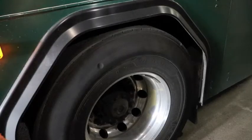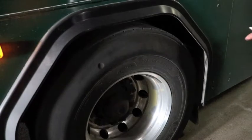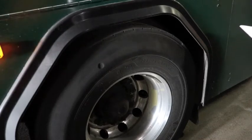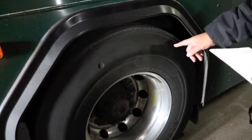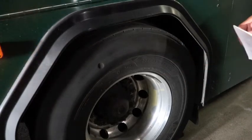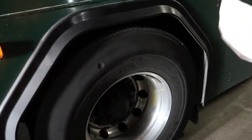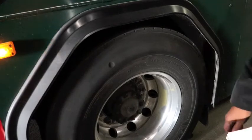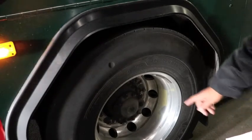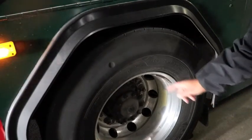At the rear tire, you'll talk about the brakes. This coach also has rear suspension — check the shocks and airbags, properly mounted and secure, not damaged and not leaking. The torque arm — properly mounted and secure, not bent, not damaged. The torque mounts — properly mounted and secure. Check brake hoses and lines — properly mounted, not leaking, in good condition — and the brake chamber is not missing, properly mounted and secure, with a clamp on it.